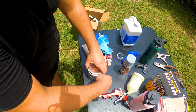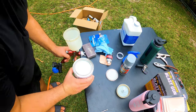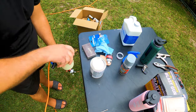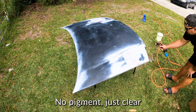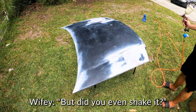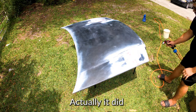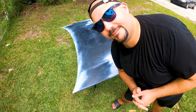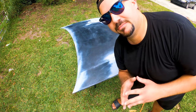I was really excited about moving on and actually getting paint into the gun, and in my excitement I forgot to read the instructions. I assumed that 'straight out of the can' meant straight out of the can — I didn't shake it, and I paid the price for that. Quick note: make sure you shake the can like it says in the instructions. Just thought I'd mention that.